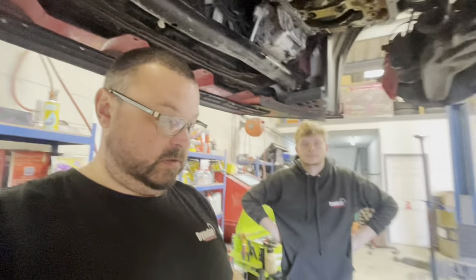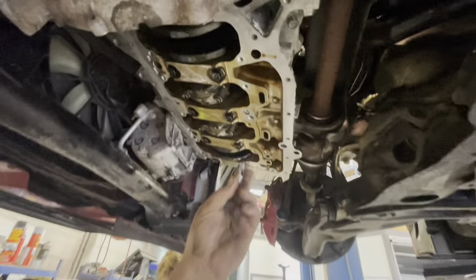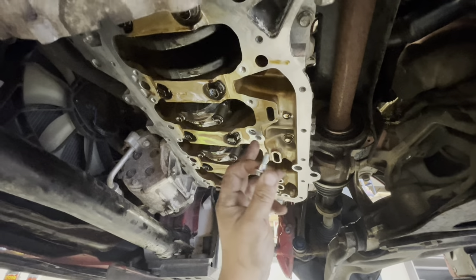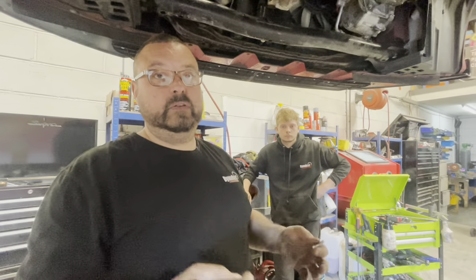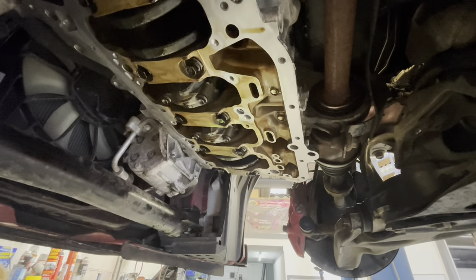Okay Richard, we're back underneath the FN2. Just something I want to talk about first because it gets covered up and you don't see it. Basically the balance shaft has an oil feed hole to feed that, so it's got oil. You have to remove that little cap from that point there and then basically that bolt screws back in there and blanks that off — obviously to stop loss of oil pressure, because it would normally be going into the pump and serving a purpose. Obviously now that the pump's not going to be there you'd be losing a lot of pressure through that for no reason. That's in the kit, yeah. So that's quite important — it's the first thing you've got to do before you start bolting the pump up and windage trays.